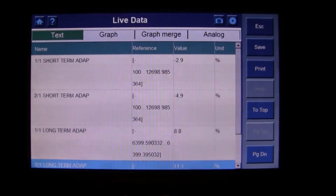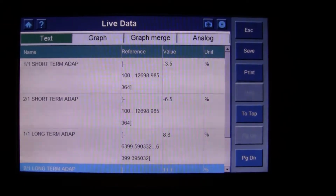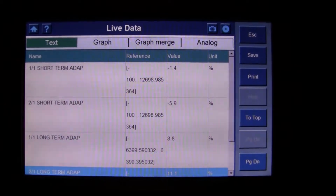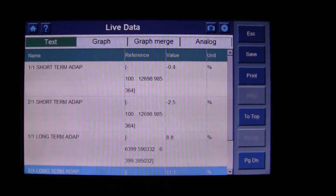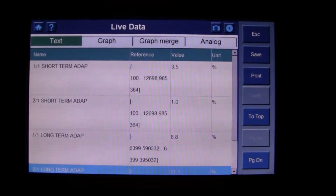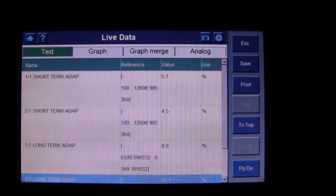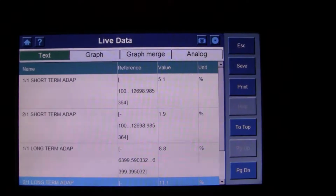Some of the things I have done is I have checked for vacuum leaks. I've looked all around the engine, your classic approach. I've been using brake clean. I haven't introduced propane or anything like that, just something with some ether in it, to see if it would change the readings on the O2 sensors. I don't have a very good graphing meter to watch the oxygen sensors and how they respond. The scope and the graphing on this is very slow and doesn't respond quickly, so it doesn't give me very accurate information on the oxygen sensors when you introduce anything flammable around the top and sides of the engine. I checked around the intake and the throttle body, sprayed everything down and tried to find a vacuum leak, but I couldn't find one.